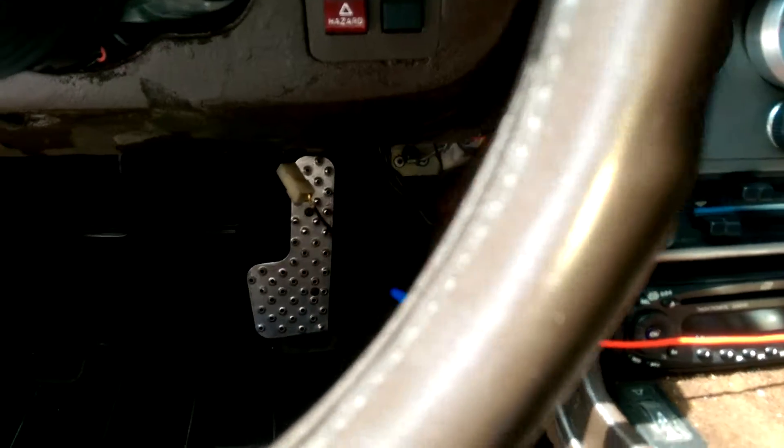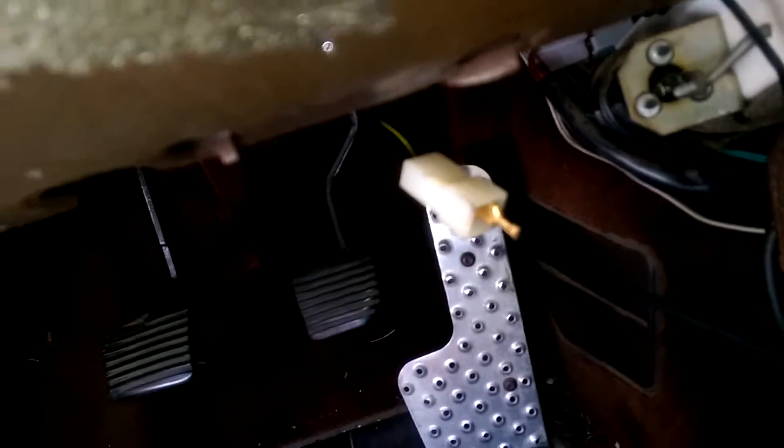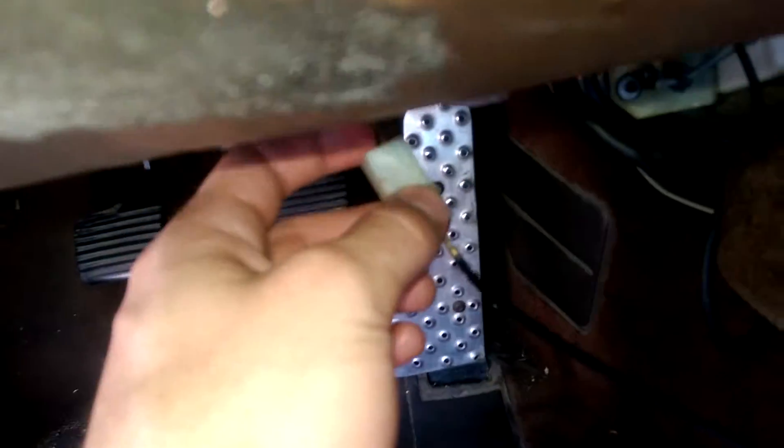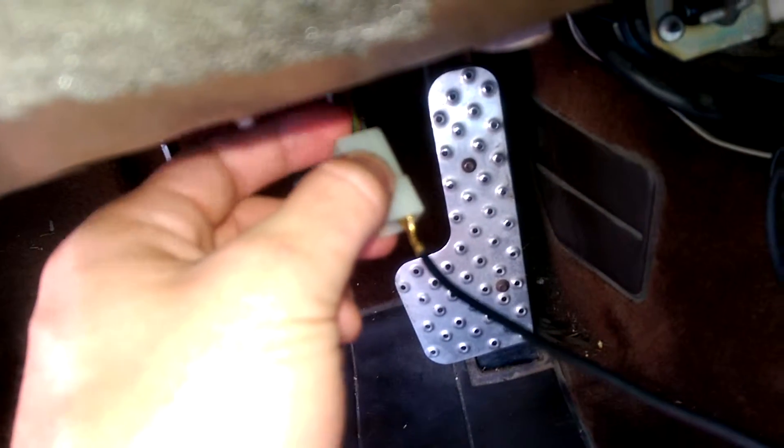The last thing is this wire here. It's temporary until I wire it in and tuck it behind the cluster - the pods here. All this is is 12 volts from the relay board I made that goes into this connector here. This is the DME harness connection on an early car - down here there's a little thing that comes off of it. There's a solid black wire on the right, which is what this goes to, and that's 12 volts. And a yellow and black wire on the left, which a lot of DME pin assignment charts will say is tachometer. It's really for the economy gauge up here, and the tachometer signal, like I said before, is that green wire.